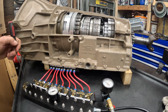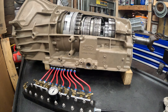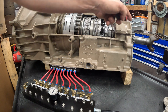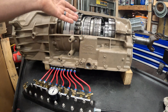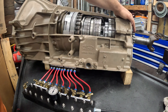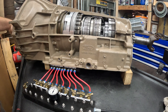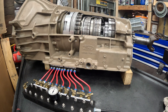We're not going to do much with the torque converter today — that's down the road. Air pressure is hooked up, showing about 32 psi on the manifold, all valves are shut. One thing I am missing is when you do this sort of thing you really ought to have a load on the output, because there's a lot of drag in here — things could turn over that normally wouldn't if there was a load on the back. This is the zero state I'm going to return to between every gear. The reluctor tick mark is at the top. I'll make single revolution turns on the input and calculate the ratio based on where it winds up — 18 teeth, each tooth is 20 degrees, so we can eyeball an estimate.